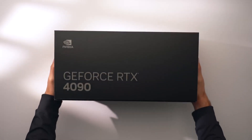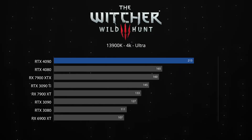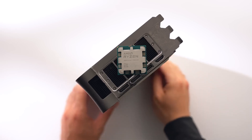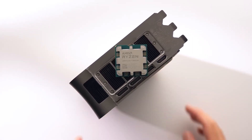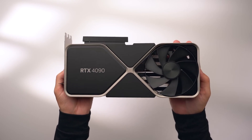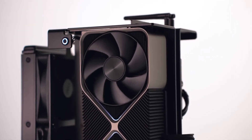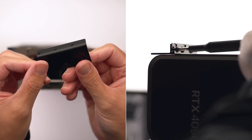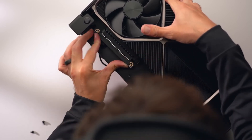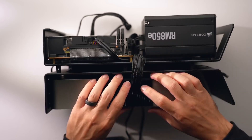Now it's time to install the GPU – I'm going to be using the RTX 4090 Founders Edition. This GPU absolutely dominates all others in performance but it is quite expensive and overkill for most people. The Founders card is hard to come by – I've only seen it drop on Best Buy once per month and it sells out quickly. This case supports GPUs up to 345mm, so most third-party cards will fit too. Take the graphics card I/O fastener and secure it to the 4090, align it to the I/O hole on the case, fix it with three screws, slide the PCIe riser cable onto the GPU, fasten that to the standoffs, secure the bottom GPU fastener, and plug in the 12-volt high-power cable.